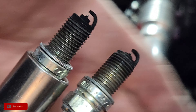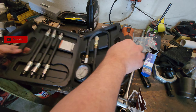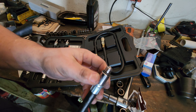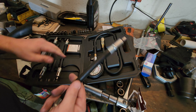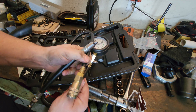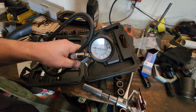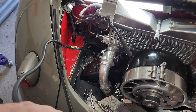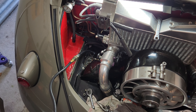I guess they're about the same. I would say number four looks maybe a little darker. Good old Harbor Freight compression checker - quick connect, disconnect. You got three different sizes in here depending on your spark plug size. Ours is this one, and if you had a stock VW it would be the other one, the little bit bigger one. So we hook this thing up and just kind of screw it down in there - you don't go crazy tight with it. Then you hook up your compression checker and run the engine over. Just turn it over a few times and see what she has. You don't go crazy with the starter - for about two, three seconds you run that thing, and we'll see what our compression is at.